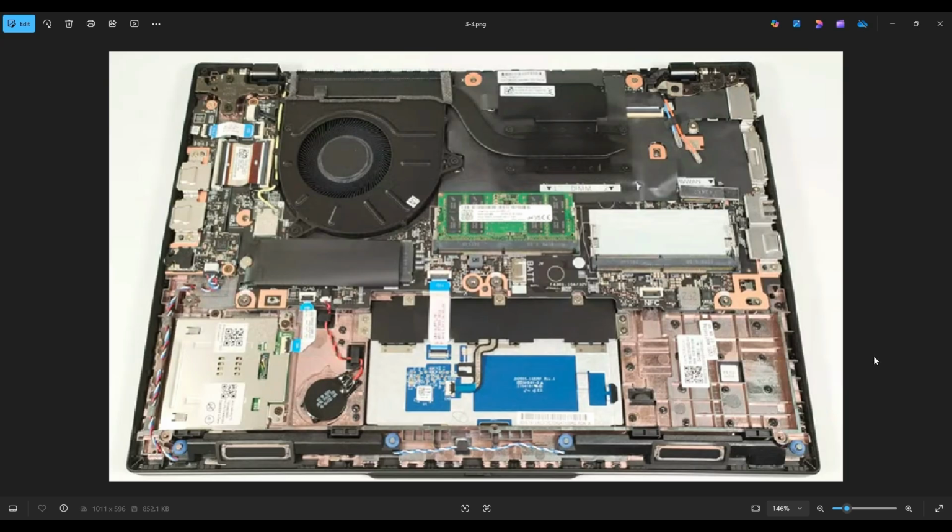And I guess the last thing to mention about this kind of operation, if you're having sound quality issues, if your audio is not consistent across different areas in your computer, it could be a system or driver issue. Your speakers could be okay. So in that case, try troubleshooting first. I will have a video link below in the description. It'll show you how to fully update Windows 10 or Windows 11, depending on which one you're using, so you can make sure that your system and drivers are all updated. Maybe you can fix your issue that way and not have to come in here for an invasive repair like this.